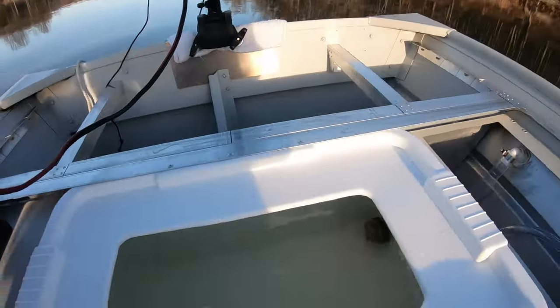Back in the lab — let me show you what I did to fix the problem. The tube that pumps water into the live well was zigzagged — it came from the pump, turned around, dipped down, dipped up, then went into the live well. That created an air lock. When you have twists and turns in the tube with air trapped inside, it creates a lock that these pumps can't pump through. I broke out my heat gun and applied just enough heat to make the tube more flexible, removing the natural curvature that created the resistance. After heating, I ran the tube straight from pump to live well in one direction, fixing the air lock.